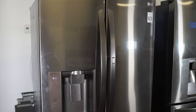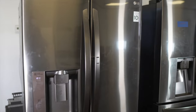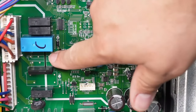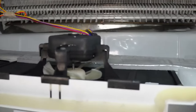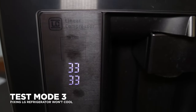Note that these lights could flash inside test mode or even before you run it, so look for them both ways. Press the button again for test mode two — this will close any damper on the LG refrigerator and just run the freezer portion while keeping the compressor running. This can help isolate a fan or damper issue. If the second test is running, you should still see and hear freezer fans running on most models. Pressing the button a third time yields three beeps and shows the number 33 on the screen, though this can vary by model.